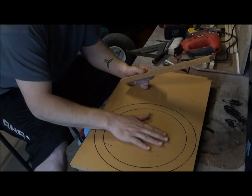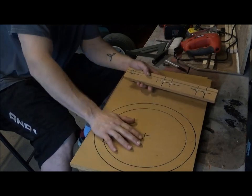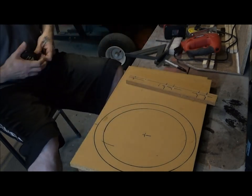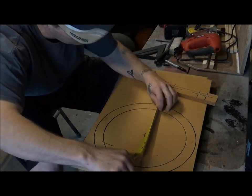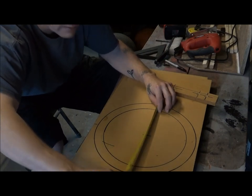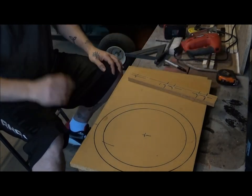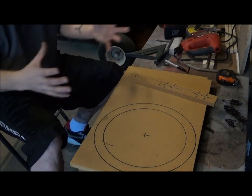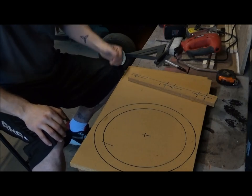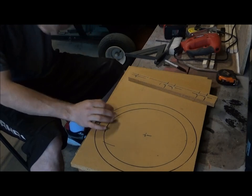The reason I did 11 inches is because the sub I'm using calls for 11 inches. You can check and make sure your measurements were good by measuring. Yep, well, we're at like 11 and an eighth. But that's okay. You can have a little bit of squeeze room, and some subframes are actually just a hair bigger than others, and some are a hair smaller than others. But if I'm running at 11 and an eighth, we're good for my 12-inch sub.